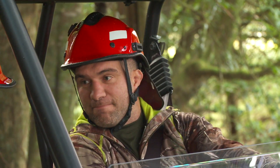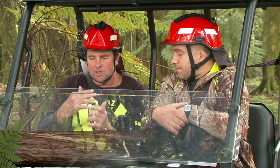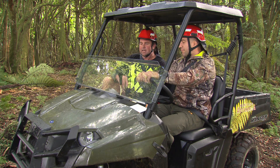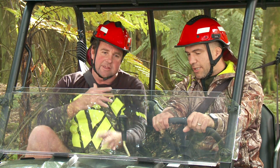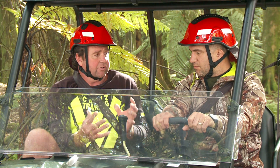What's our tip for today? You can see we've got a drop-off coming up here, so a descent. What we need to think about is how steep it is, how much gravity effect we're going to have, how much traction we've got. We must go down in low range so we get the best control and also make sure we're in four-wheel drive. Most of these machines on the market run a CVT transmission.